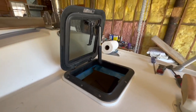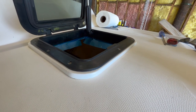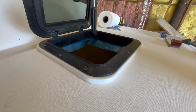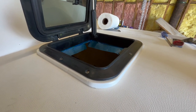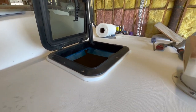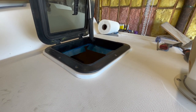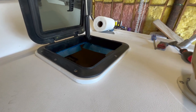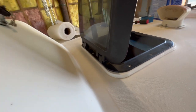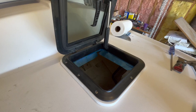I've got it in. That bottom HDPE — or whatever it's called, the cutting board material — I've got that installed with 5200. I know a lot of people will say I should not have used that, but I wanted to make sure it did not leak. It's hard to get stuff to stick to that and hold it really well, and it's a pretty exposed spot there, flush with the deck, for water to get in. So that's sealed up with 5200, and then the hatch itself is sealed with 100% silicone because that's what the manufacturer recommended.